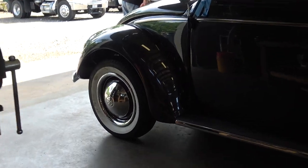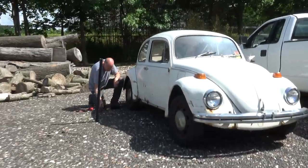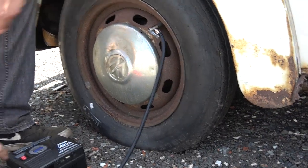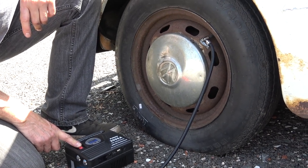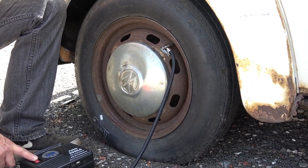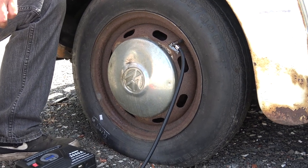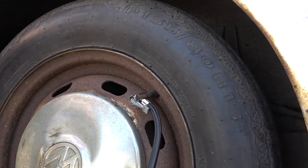Here's our 1970 Beetle — heading over to this back tire which is almost flat. You can dial in how much PSI you want, which is really cool. For a Beetle with radial tires I usually put about 28 in the back. The manual recommends high teens for a bias tire, but for a radial I go up to 28. For a modern car on the side of the road you'd probably need 32 to 35 pounds. She's hooked up — basically just like a typical bicycle pump fitting.